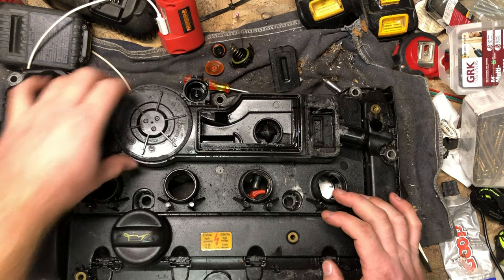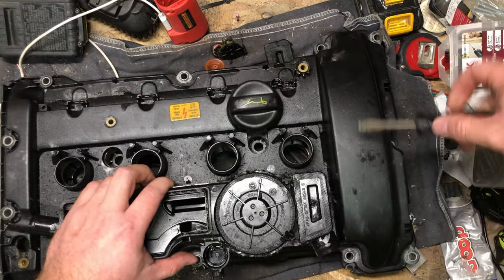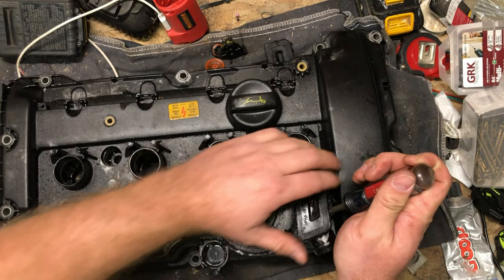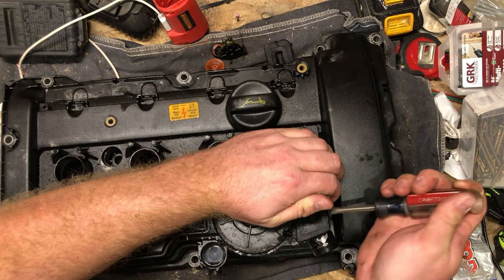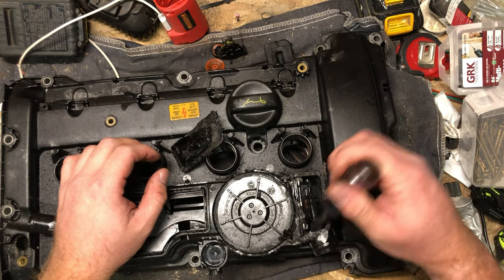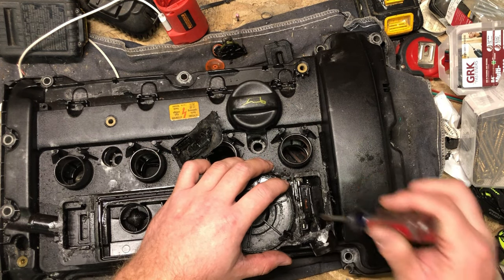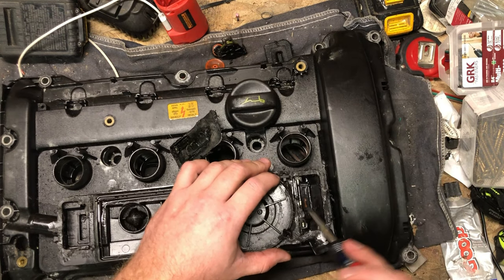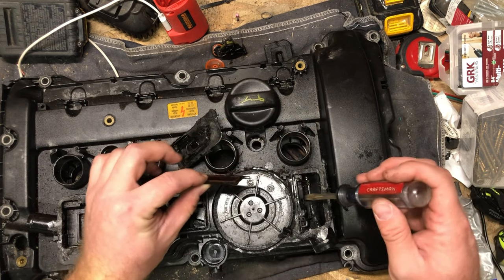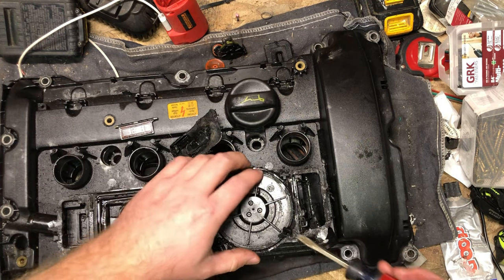I'm going to try and cut this piece off and we'll take a look at what's under here. I'm going to guess there's another flapper valve like we saw a second ago. Yeah - another flapper valve or check valve, same type of flapper arrangement. When the pressure in the engine exceeds the pressure on the turbo side or vice versa, this valve will open. Fairly simple there - kind of same thing that's going on over here.